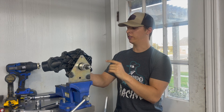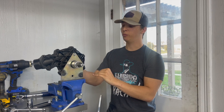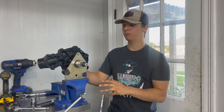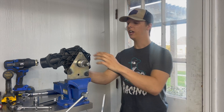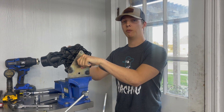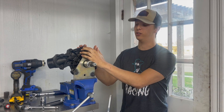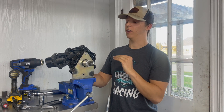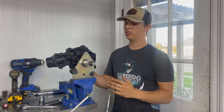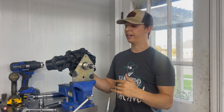I've got the jam nut torqued down and sure enough the slip on this was right at 17.8 to 17.9 pounds — right where I want it for this particular supercharger impeller. Setting the slip on these superchargers is extremely important, but not everybody is going to want to buy all the specialty tools required, especially if you have a stock ski and don't have to do it too often. So not only do I offer a rebuild service for these, but I also offer a slip setting service — links to all of that will be in the description below. I hope you guys got a really good look at how this supercharger works and understand why they do need to be rebuilt despite Sea-Doo saying these 300 superchargers are maintenance free. I rebuild these things every single day and see way more failures than I'd like — it's way cheaper to just do the maintenance than to suffer the consequences and have debris go throughout the engine.